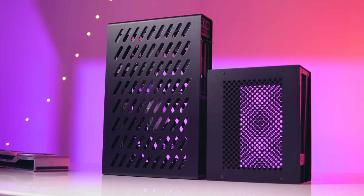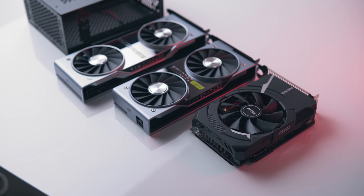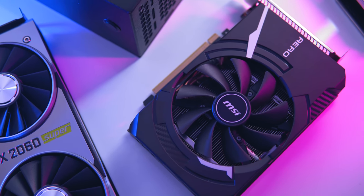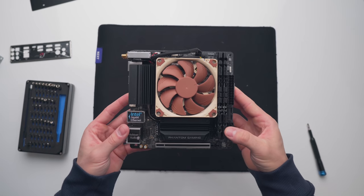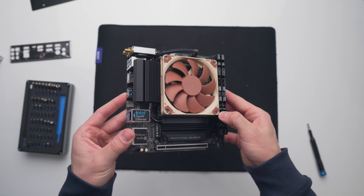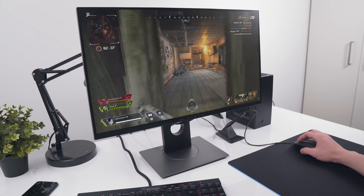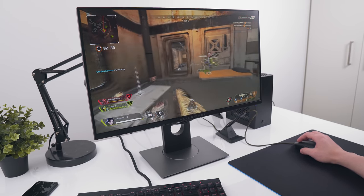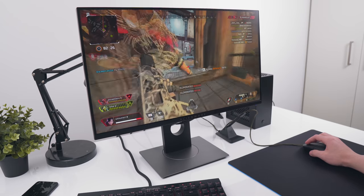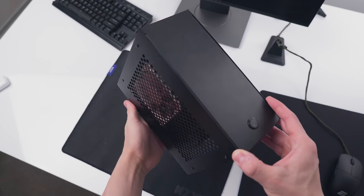Now being such a tiny case, there are going to be some compromises. Starting with the GPU, which in my opinion is the smallest compromise — graphics cards up to 183mm are supported, which means you have two RTX 2070 choices available from either Gigabyte or MSI. Only CPU coolers up to 37mm are supported with a dual slot graphics card, so in this case I went with Noctua's NH-L9i. You can configure the case with a single slot graphics card, which would allow a 52mm CPU cooler. With the NH-L9i though, you're still able to comfortably run a 6-core i5-9400 at full tilt with no issues, so for gaming I believe this is absolutely sufficient.